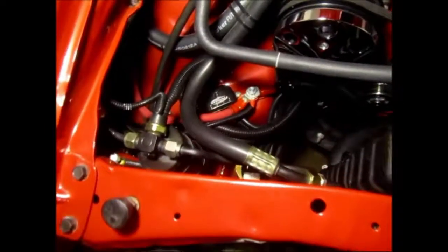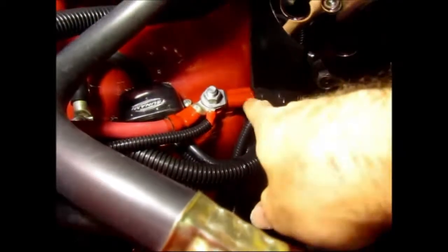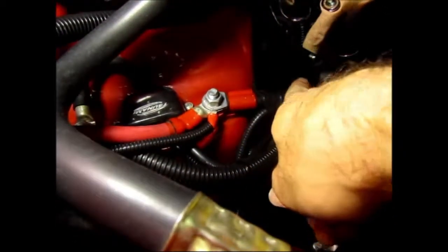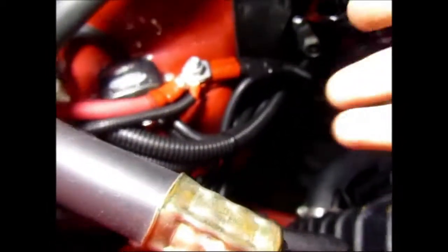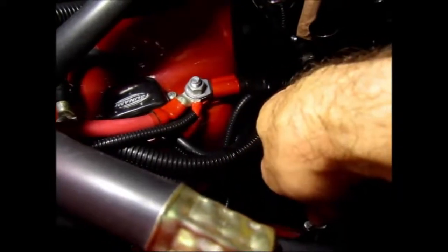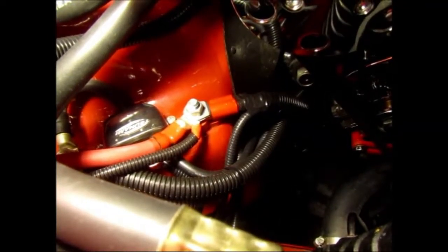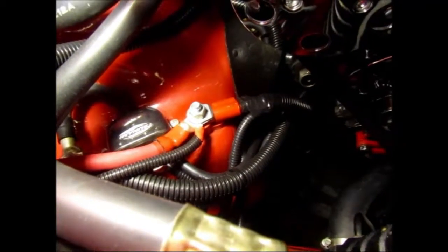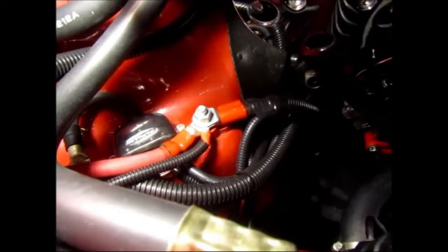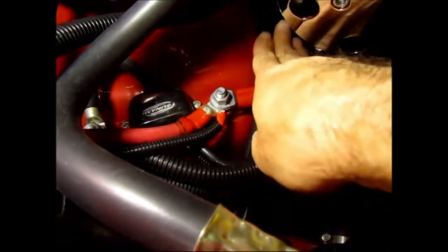Here at the front of the engine bay, let me show you the improvements I've made. Originally the car came with two 4-gauge wires — one from the battery to the starter, and the other from the battery to the head of the V8 engine. For the starter I upgraded to a 2-gauge wire going straight to it. I also upgraded the starter solenoid wire with a 10-gauge wire and added a relay so I get 12 volts straight to the solenoid without worrying about the stock wiring lacking. Those were the improvements I made for the positive side.